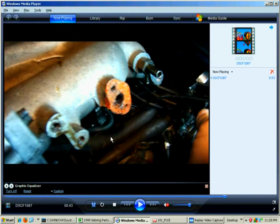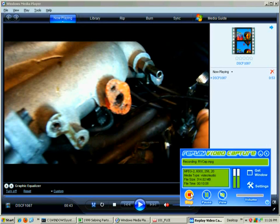When you're doing this, it's not so daunting. I think the worst thing about it is if you strip out screws on this stuff, because a lot of times it can happen because the cars are older, and this manifold comes off for many different things you need to do. It's aluminum, so after a while bolts will strip out, but they're not that difficult to repair. But the way to do it is not with helicoils. I would go to McMaster and get the proper stuff, and I'm probably going to cover that in a later video to show exactly what sizes you need. I'm also going to do another video on taking out the upper intake manifold, because then you can do your distributor a lot easier. So I'll go over that next in another later one.